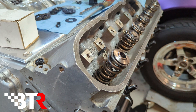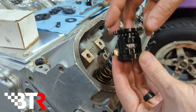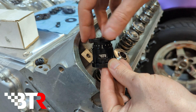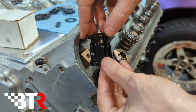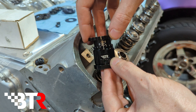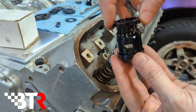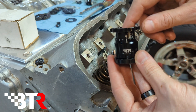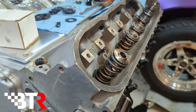That's what I'm doing with this conversion. I just wanted to show you guys real quick these two really cool tools from BTR to help with this whole process. And with the spring height tool zoomed in — it says BTR there — as you open this up, you can see the markings. As you turn this, every time it comes around, we've got six and then it's marked. So that would be 1.61, 1.62, and so on. The spec we're looking for for this setup is 1.70 up to 1.72, and on the one we did, we ended up right about 1.715 or 1.716. It's really easy to grab with your hand and fits in there nice. Highly recommend this if you're shimming your springs. I'll put some links down in the description to these tools, and if you have any questions, be sure to comment below and I'll answer them. Thanks a lot.